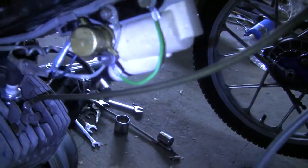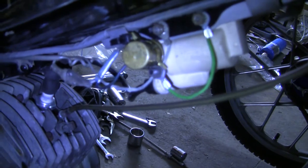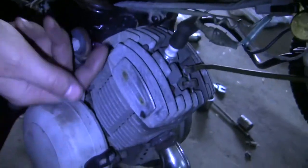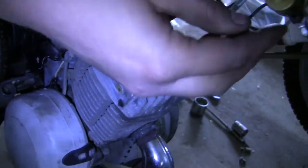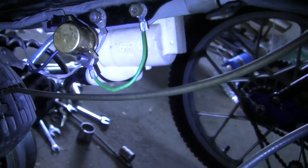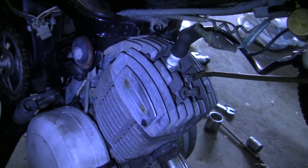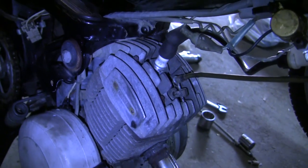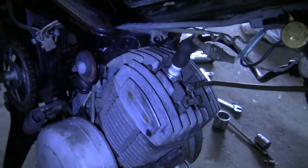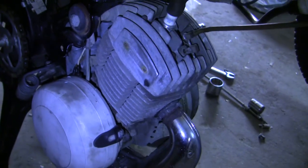All these ground straps are always just this exposed wire. Because the engine pivots and it's got rubber mounts, it's isolated from the frame, so you need to run a grounding strap from the motor to the coil — the coil is grounded. The condensers used to be mounted under the flywheel, which would get really hot and those would almost always fail. The current position is still pretty dumb — it's behind the flywheel where it's exposed to water, salt, whatever, and it still gets pretty hot. The ignition system on these is always a nightmare. I've never gotten a Mobi that sparked right off the bat. On the yellow one, the ignition points were bad, and even after cleaning them ten ways to Sunday they just wouldn't work — you had to replace them.